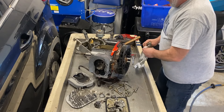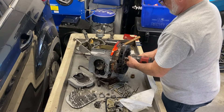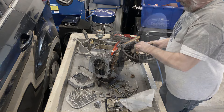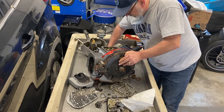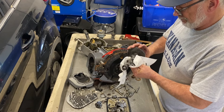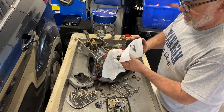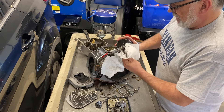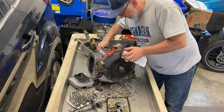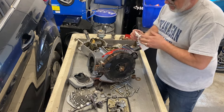I think I'm going to have to take the flywheel off. The camshaft has some pretty heavy wear on the tops of the lobes — I'm sure I was floating the valves pretty much on this thing. I need to get this flywheel off.